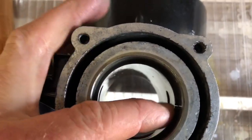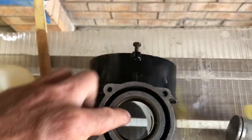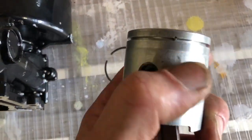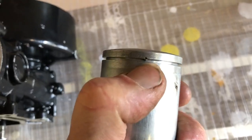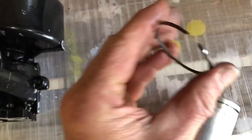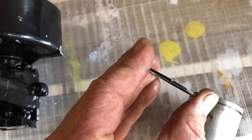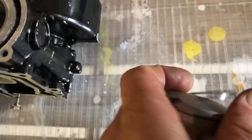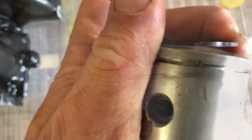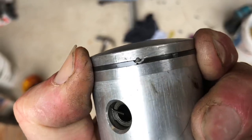That's where the motor runs. This obviously expands and you don't want this little gap to close up and the ring to get locked in there and seize your motor. Another thing you'll notice with this ring groove in this piston is there's a tiny little locating pin at the top, and the ring has a little section for that. So you've got to make sure you put it in the right way up so that those notches sit around that locating pin, and when it's in the piston bore those will close up around that little locating pin.